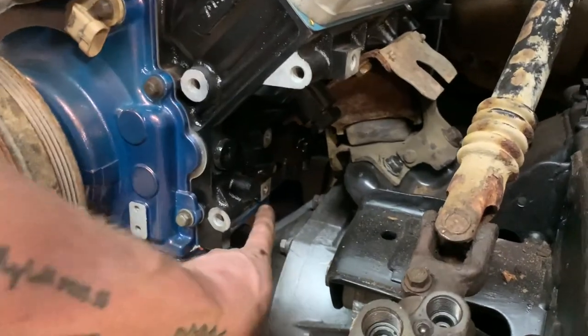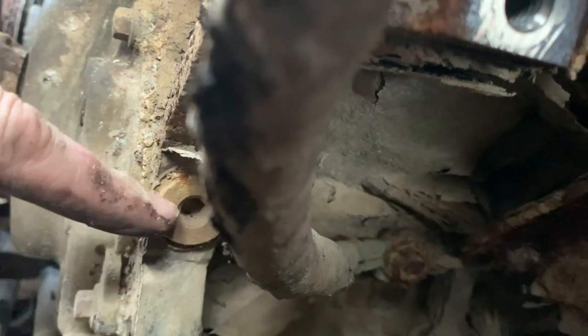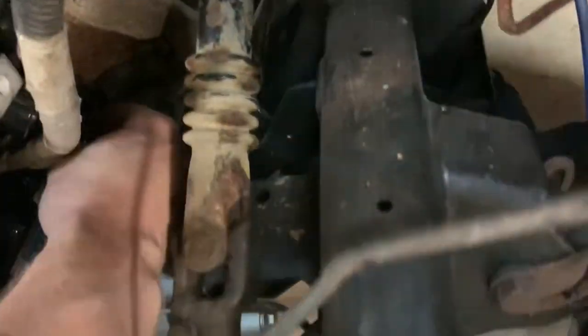As far as I remember, I think it goes here or there, but I'll go out and check out another engine to be sure. Let's see where this ground wire goes. Oh, this one has it. Yep. All right, let's see. Down here, over there. And it goes to the bolt directly behind the oil pump thing, right there. Alrighty, a little more of my favorite gloopy stuff. And tighten it up. And we have a ground wire.